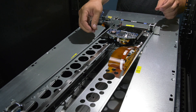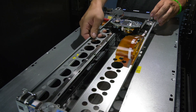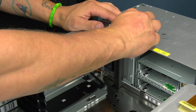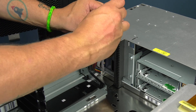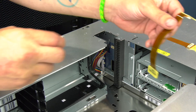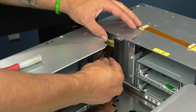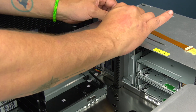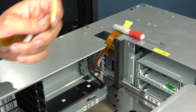If you do not need to replace your picker cable or spool, you can skip ahead to the robot reinstallation. If this is an I3 base module, you will likely have a single small robotics cable that is amber in color. It can simply be detached from the circuit board inside the library cavity and replaced with a new one, ensuring that you attach the correct end to the circuit board as notated on the cable.